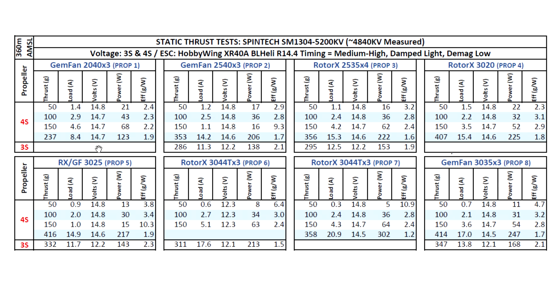When you compare the thrust test results to the 1106, we can definitely see that this motor is performing better than an 1106. Compared to the 1108, it's lower performance than an 1108. The weight falls right in between an 1106 and an 1108. The main theory behind this size motor is the control — this wider stator is supposed to have better throttle control. I haven't flown this motor yet, so I really can't confirm that's the case, but I'm sure quite a few people have already been flying it.